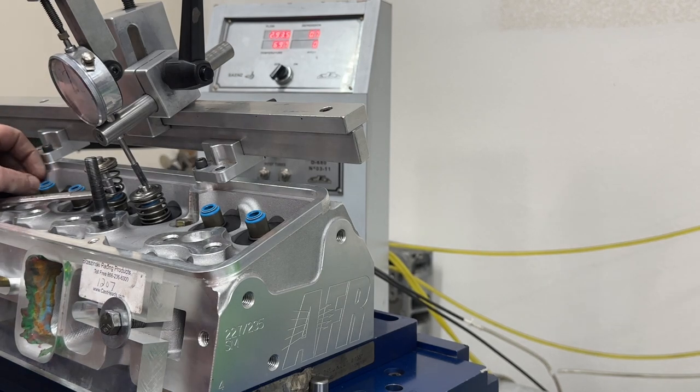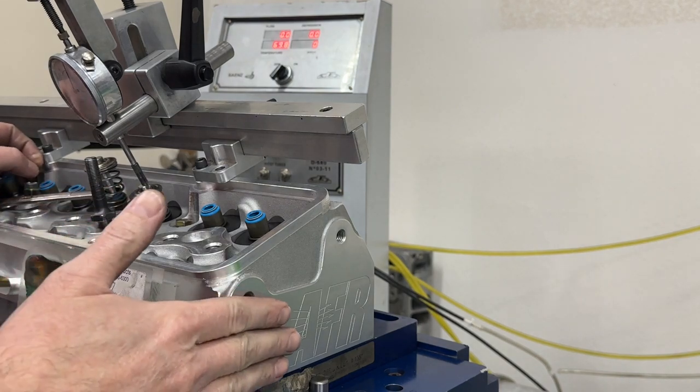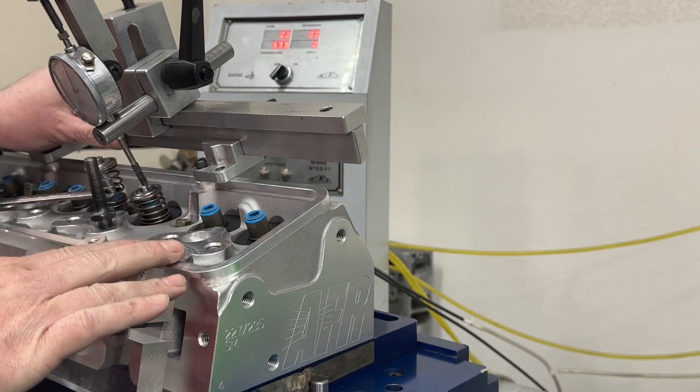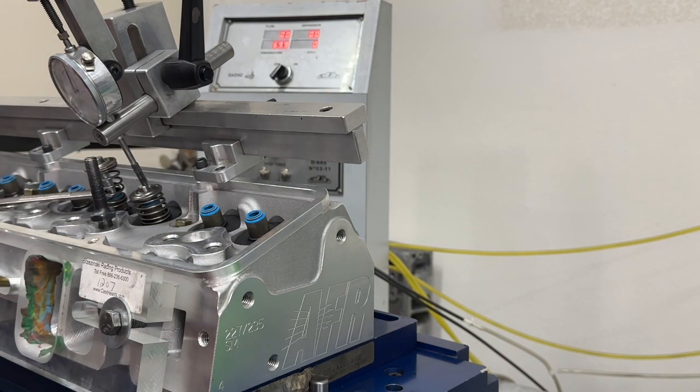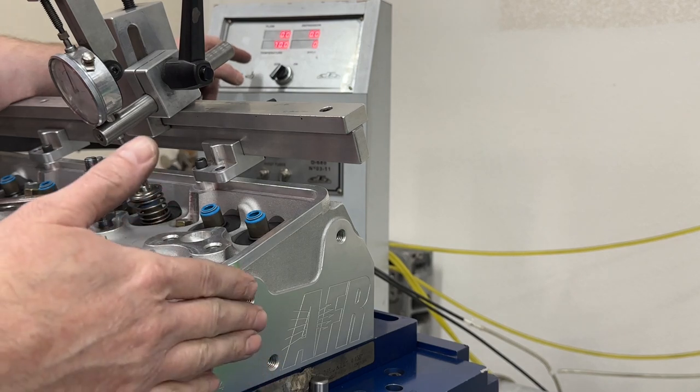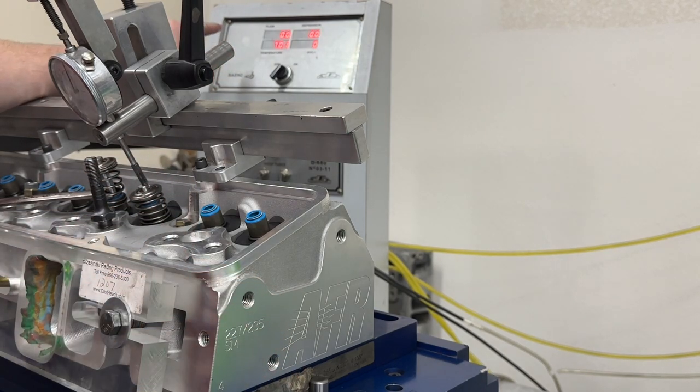Well, it didn't do it. And as you can tell, it only flowed 325. The reason why I wanted to show you that was this. There are times when I'm flowing these AFR heads, it's only on AFRs, I'll put my radius plate on, set up exactly like this, and when you get to 6, it's like 323, which I'm like, man, that's insane, because my ported Dragon Slayers do that. But I'm like, 227, no way. And so anyway, I'll go up to 700 to flow 342. I'm like, no way, that's insane. All I'll do is tap like that, and it drops to 325. And no matter how much you open it, or you can go back to 6, it won't go back to 322.